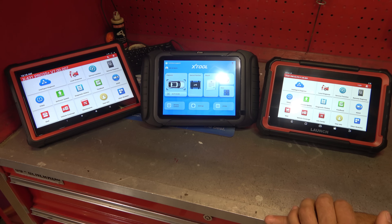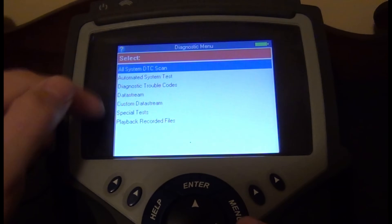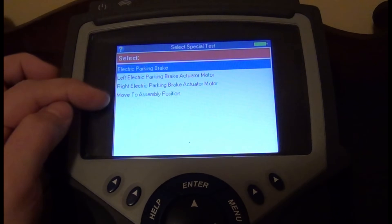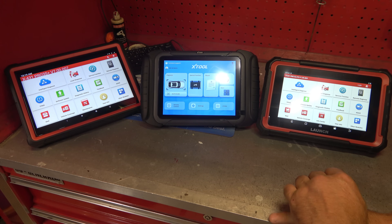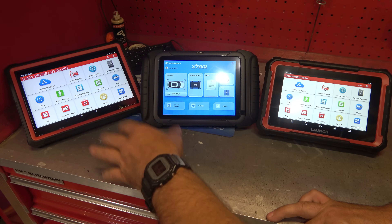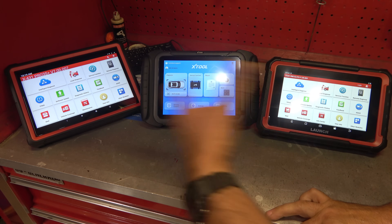And then we move into professional grade, our pro grade, our A-tech level scan tools. Back when I started and bought my first pro-level tool, it was the OTC Genesis, which later became the Genesis Evo. That worked well through 2015 when they stopped supporting it, but that tool was around from 2000 to 2015. It did offer some bi-directional controls — pretty revolutionary for its time. It was also sold as the Matco Maximizer, and Cornwell sold a version too. You'll find that a lot of tools from Mac, Cornwell, and Matco are rebranded tools. I believe Launch has Matco all over it now.